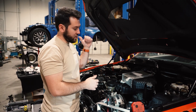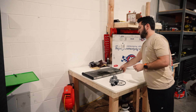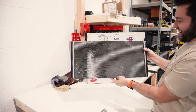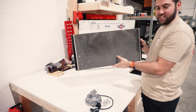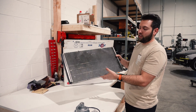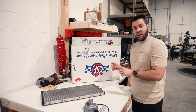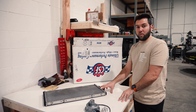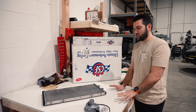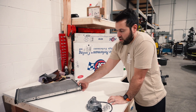You can't just run air through a tiny little heat exchanger — it heat soaks just like that stock thing does. This S55 unit is water-cooled, so more stock F80 parts. The F80 uses this heat exchanger at the front of the radiator, and in conjunction with the side one, it cools the intercooler charge air. It's a dinky little thing with plastic end caps. Surprisingly, even the F82 endurance GT3 BMW race cars still use this factory unit for their 24-hour Rolex cars — limited to 450 horsepower, but still crazy.